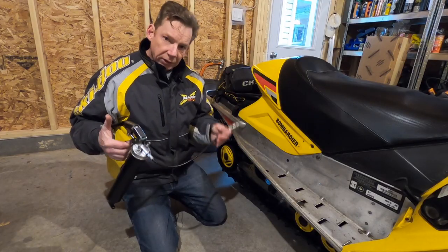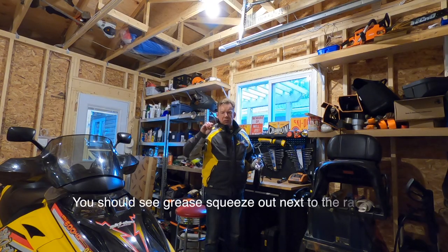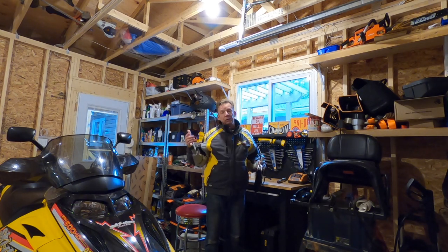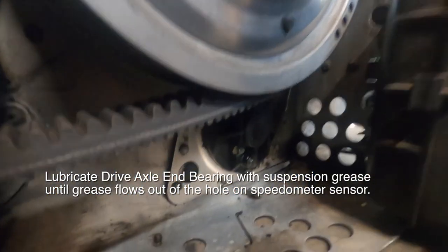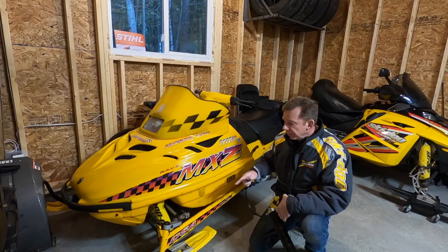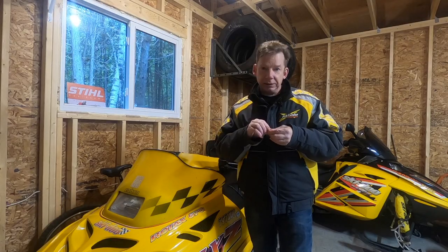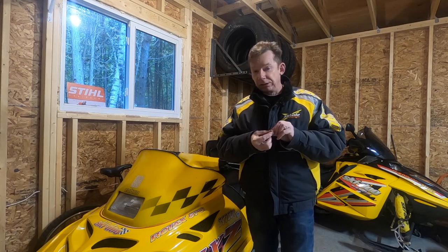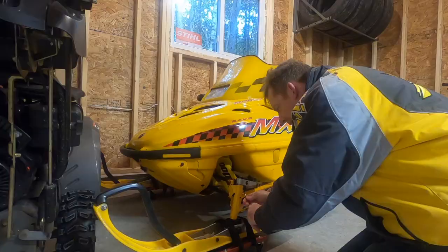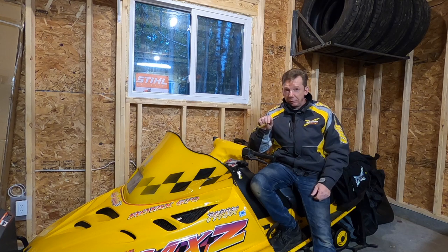Once you find all those fittings, just take your grease gun, press the coupler onto that fitting, and then give it two to three pumps on the gun. If you see any grease squeezing out anywhere, you've got enough in there and you can move to the next fitting. Once you've got them all, you're finished. Now this Rev also has a grease fitting in the end cover for the rotational sensor that drives your speedometer — that's down underneath the secondary clutch. Sometimes a grease fitting will get blocked with dirt or dried grease and you can't get any grease into it. Just grab a 7mm wrench, take it out and clean it. You can use a pick to carefully remove anything you can, then spray something like WD-40 or brake cleaner in there, use your compressor to make sure none of it's left, put it in the grease gun and squeeze some grease through to make sure it's clear, then reinstall it. Just make sure you have a pair of needle nose pliers handy to pull it back out of the coupler, and be really careful when you thread it back in.